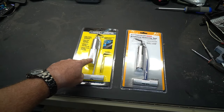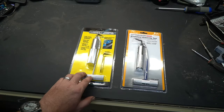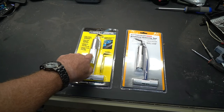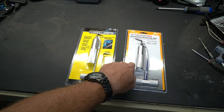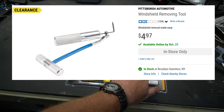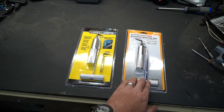This tool right here is used to cut actual urethane. It's got a sharper blade, a little more tempered steel on the end, the handle placement is a little different, and it comes with an extra blade. This will get the job done on newer vehicles. Basically any car we have today, unless you're doing an old restoration, is going to require this tool, not the butyl one. I also noticed on the Harbor Freight website that the butyl cutter is under clearance, so it looks like they're not going to sell it anymore — probably because people got confused and tried to use it on a urethane-glued windshield.